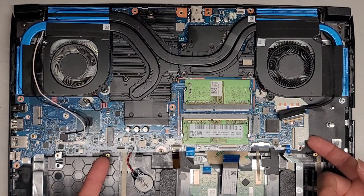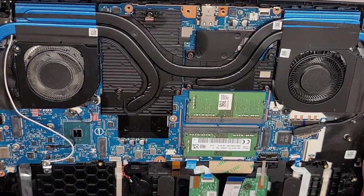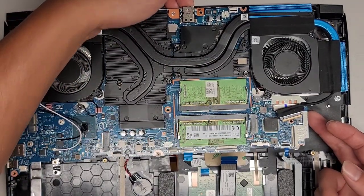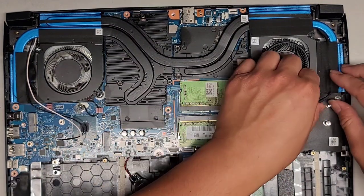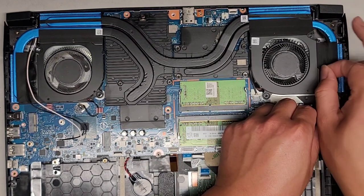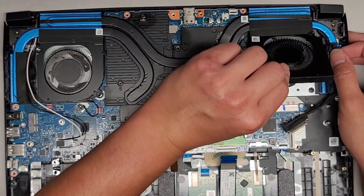Let's carefully try and lift this motherboard up. You can see it's lifting. One thing to take note of — sometimes the ports do stick out into the chassis. It doesn't look like that in this case, but if so, you have to lift the board at an angle. Let's try pulling this out. This cable is also trapped under here, so we're going to peel it from the fan side. You would be able to remove the fan without removing the motherboard — you do have access to it.